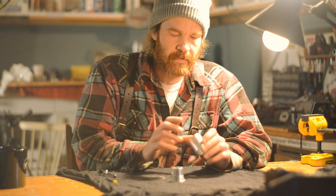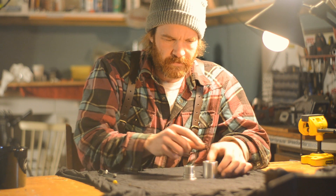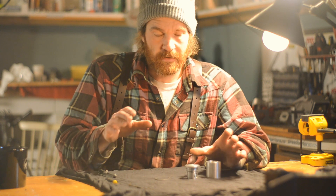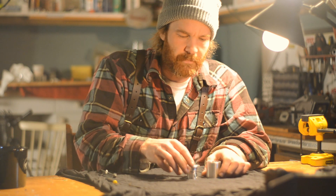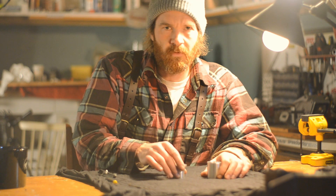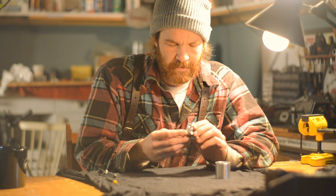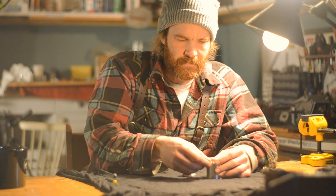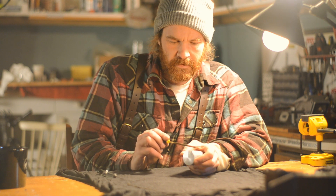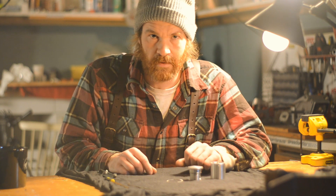Welcome back. As I said in the previous video, there's a new version of this piston being designed and made by Mark Atkinson with a larger ledge. Also, we're getting some spacers made to be able to run the pistons without the step and have them clamped together properly. If this doesn't make sense, please go watch some of my other videos. The world's most powerful two-stroke is behind me. Last night it dawned on me — this precision surface doesn't have to be precision. It's just clearance for the ring. The ring seals against the bottom surface. So I'll just file the top ring land to give enough clearance for the ring. That's what we're going to do now, and if it works we'll assemble the engine and test it.